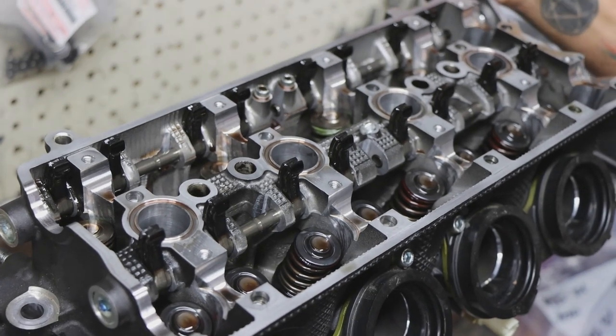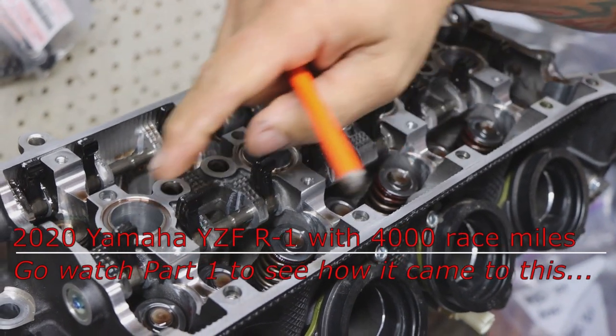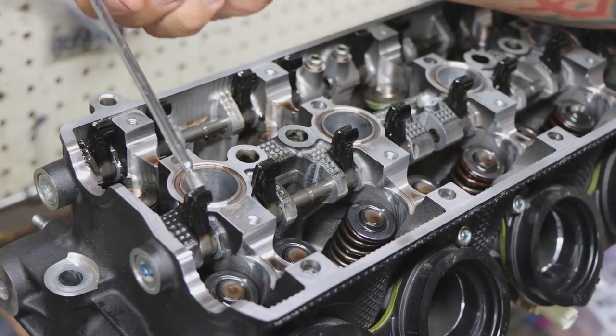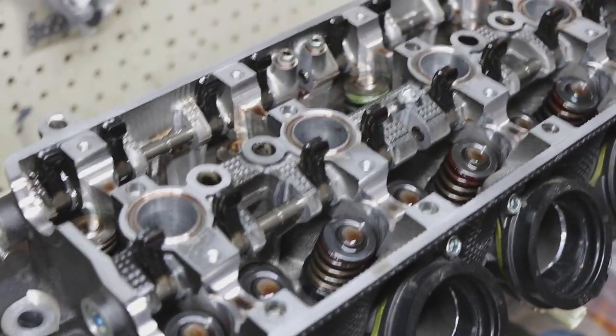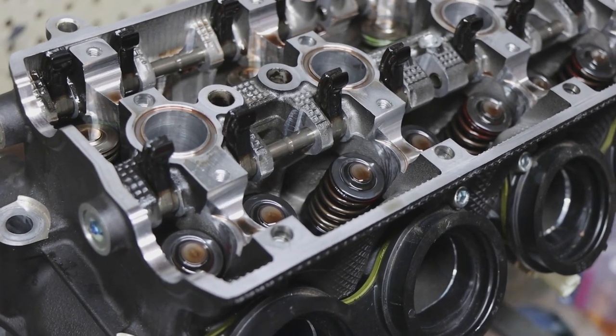You're looking at the valve train with the cams out of a rocker arm style head. Normally the cam is here pushing down on the rocker. We're just going to pull everything out of the way. First thing you do is pull all your shims out. Otherwise, when you flip that over, you're going to lose all your shims and lose the order of where everything was.